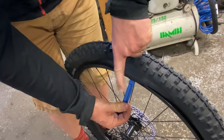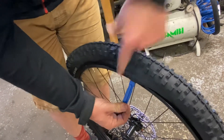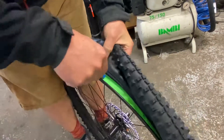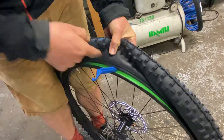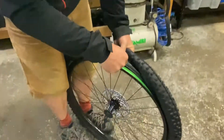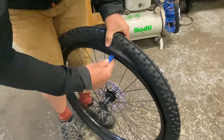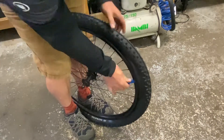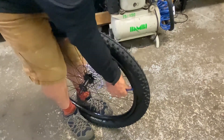You're only taking one side of the tire off, not both. Some people put the tire lever too far under and grab the back bead trying to pull it all over — you don't want to do that. Just one bead. Put the notch on at three o'clock, thumb on the back, push down.